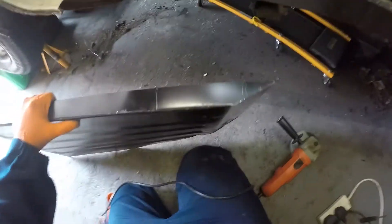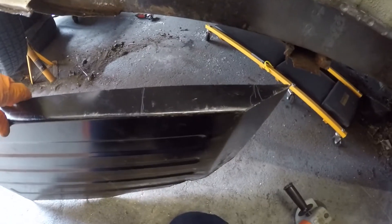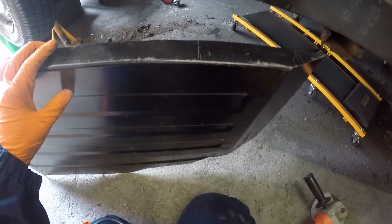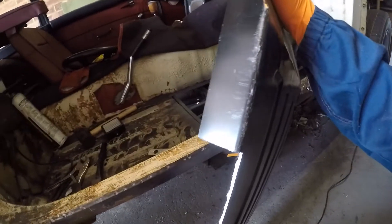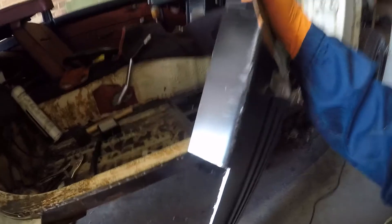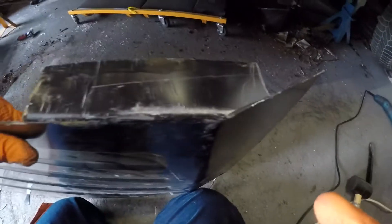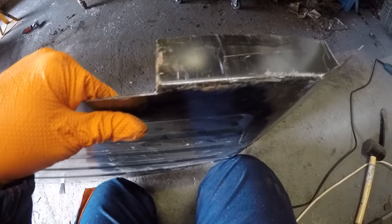To properly test fit it, I need to cut this side as well. I've marked up roughly where I need to leave some material and hopefully I've got it in the right place, so now we're going to have a go at cutting it. That side is now cut, leaving a little tab for where we can repair the step sill. I've scribed it after fitting up, and I've cut a little bit too much off here but I'm sure I'll be able to just patch a new bit in.